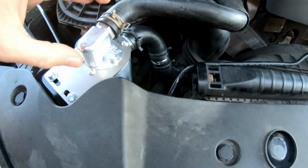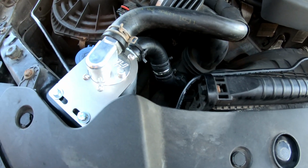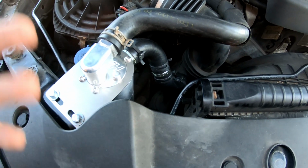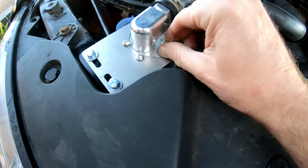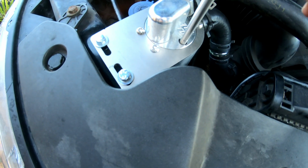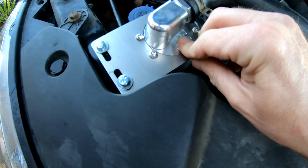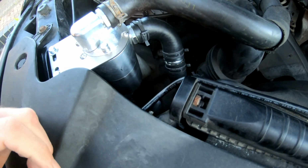It just means any oil that does get caught in there catches to one side a little bit more than filling up levelly. But the dipstick's on the right side of it there, so it's going to be on that side where it pulls up more, so at least you're still going to be able to use the dipstick, and that will be effective.